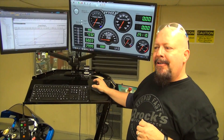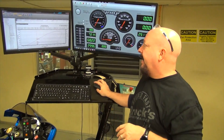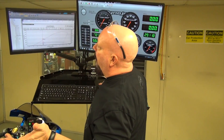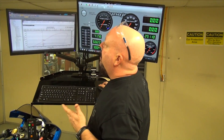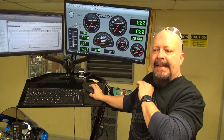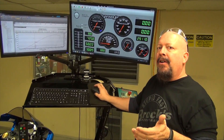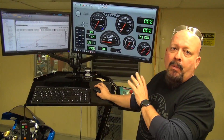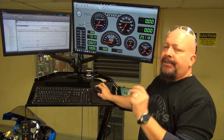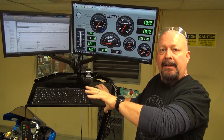Where are we going next? We are squeaking up at 204 horsepower and we are still on MR12. That's a great number. But I also want to remind you guys that if you go back to our conditions video, the dyno room got relatively hot because we were dynoing here quite a bit, but the humidity is only 17%. Will this bike make 204 in the springtime? Set up exactly how it is — no, it can't. It's going to be fairly close. When we put this bike on the dyno, it starts off with 200 horsepower and builds up to 200 and something, which is really nice.